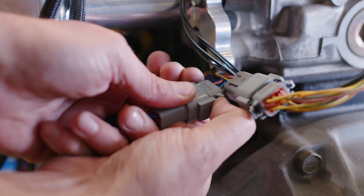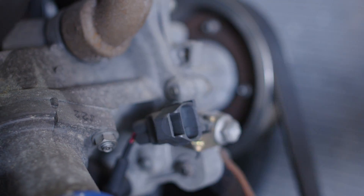In this case, the tuner might opt to look at the engine health a little further by performing an engine compression test. First, they'll disable the engine by unplugging the injectors and the crank angle sensor. Then they'll crank the engine with the throttle wide open. An experienced dyno tuner will listen to the noise the engine makes while cranking to determine if each cylinder has the same compression and if the overall compression is good or if it seems a little sad.